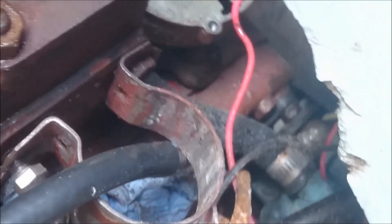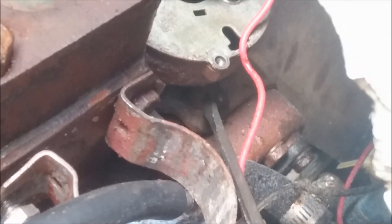There's a lock nut at the bottom. You can see it's down over here — it's a bit hard to see in there. But down at the base of the distributor, there's usually one nut that keeps it in place once you've adjusted it. So back that off.